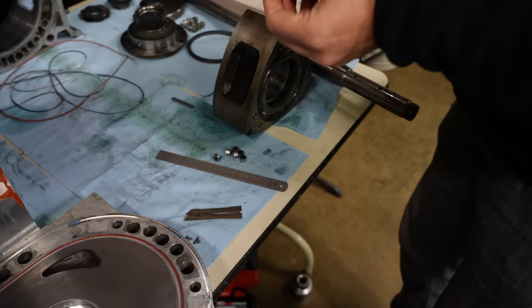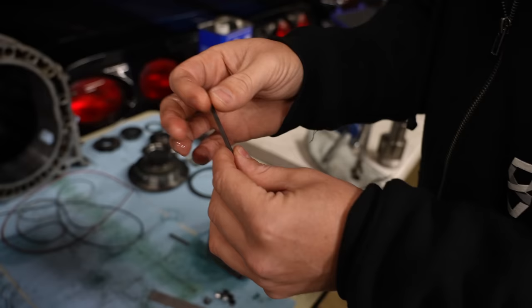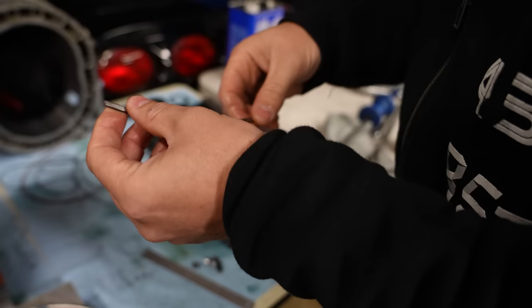What I did was take the calipers and just grab all of them at once and then pull the ones that weren't being held in, because that was clearly the largest one, right? And then continue to do that until they no longer were able to grab with the correct distance, the correct thickness, meaning that they were under spec, and I threw those out.